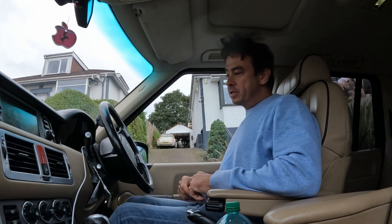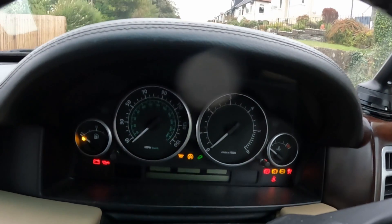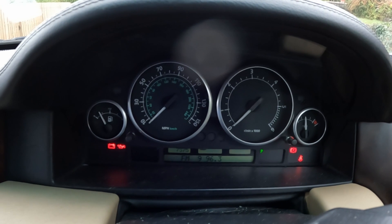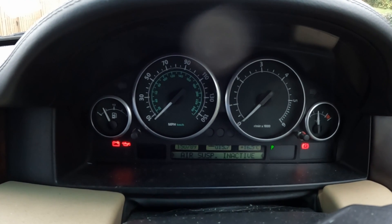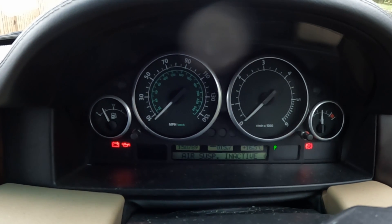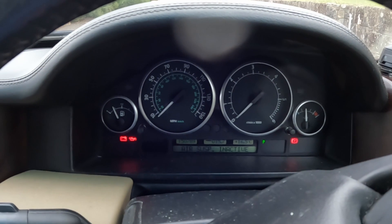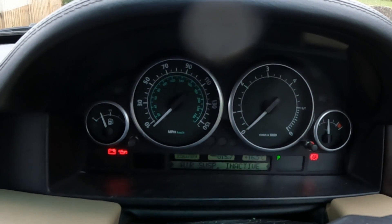There's a problem with the suspension being inactive. When you start the car, after a few seconds you get 'air suspension inactive.' I was told if you turn the steering wheel all the way to the right and left, that normally clears it — but I've tried it and it doesn't work. So let's get the iCarsoft out and see what we can find.